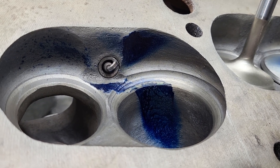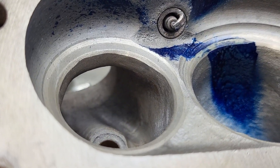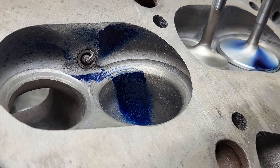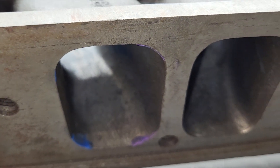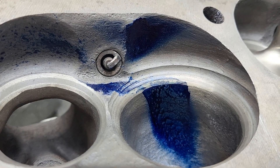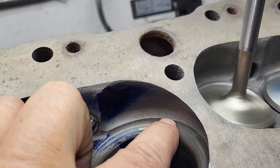It does have K-lines in it. I cut them for 2.19 intake and 1.88 exhaust. You can see the giant wide seats I did when I was a kid. This is the first set of rectangular ports I've ever flowed, and you can see they've got a nice deep chamber cut on the intake and the exhaust — I did it with a curved stone. It actually turned out quite nice; I just didn't blend it in perfectly.